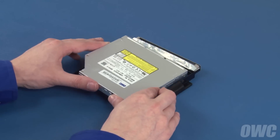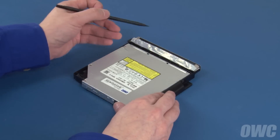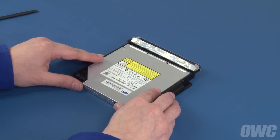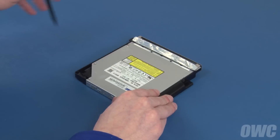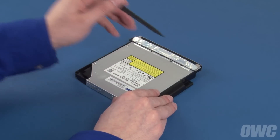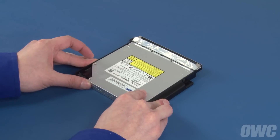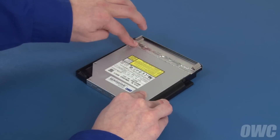Take your new drive and set it most of the way into the carrier. You can then slide the drive forward into place so that these two holes go over these two pins along the front edge of the carrier. You should also note that these three circular tabs should sit on the top of the drive. You can now fold the tape back down and reseal it — there should be enough residual adhesive to allow it to stick.